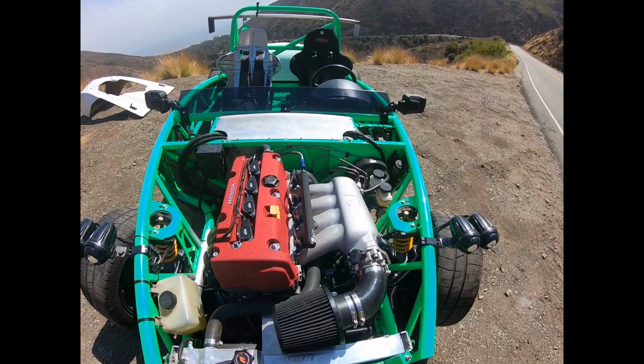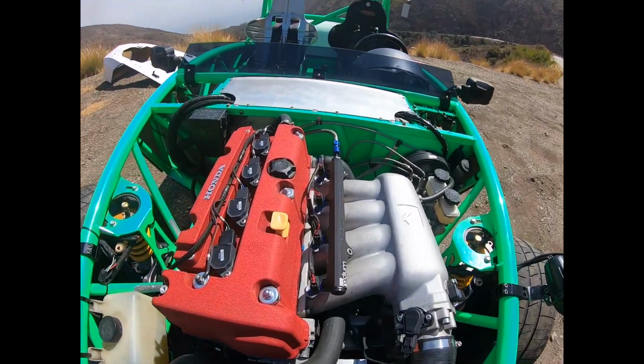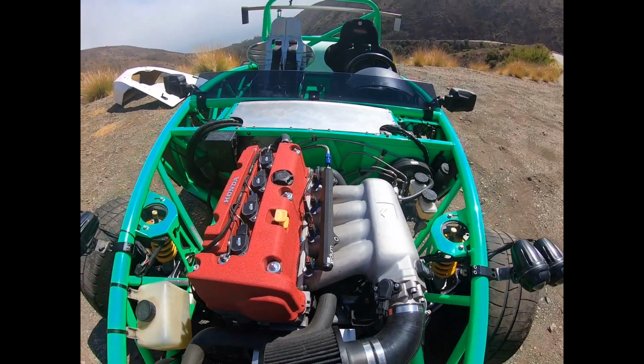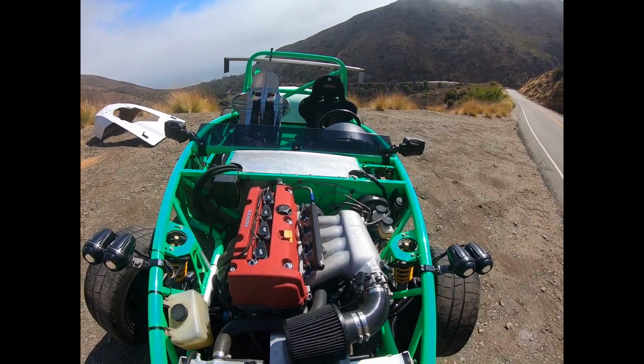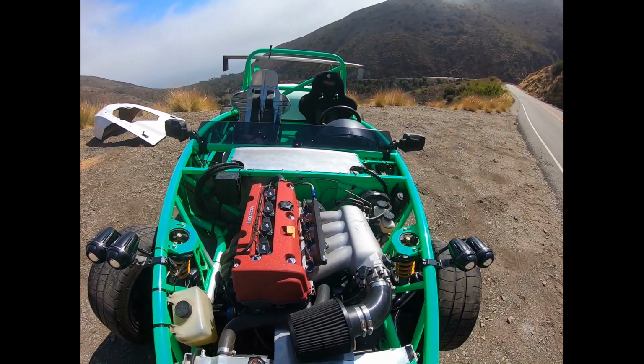And so now two things I did to solve that problem. First off, just using the RDX injectors. The car is at 250-ish wheel horsepower, and so now I think the RDX injectors are good to about 280. So they're close to top, but the tuner was okay. I think we're at 80-something percent on the duty cycle, low 80s, high 80s, I can't remember.